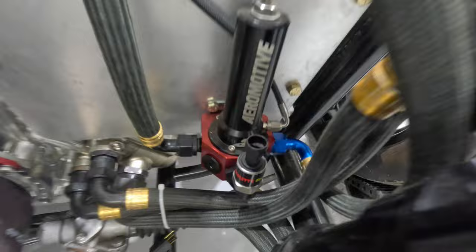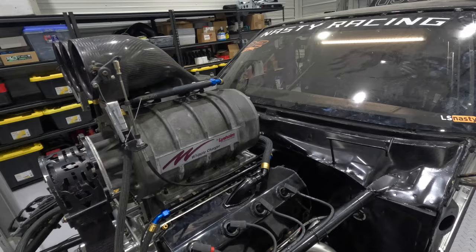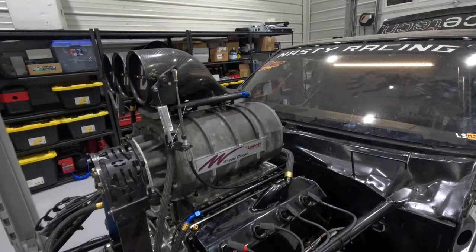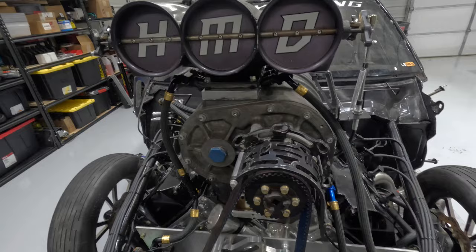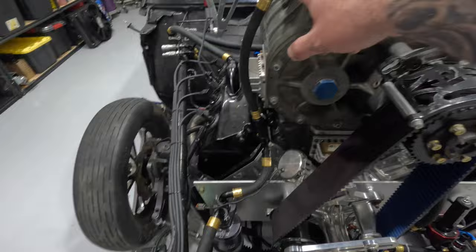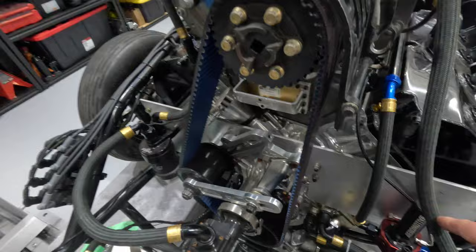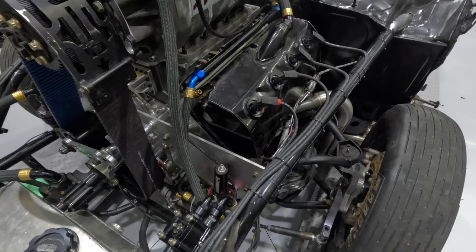There's also a Scarlet Solutions fuel pressure sensor. Something Danny Humphreys — a smart dude — shot me a message about after my last video. He pointed out something I was aware of but hadn't put much thought into. He said he struggled with this on his car, then got it working. The fuel system, as plumbed, comes out of the pump, goes to the filter, comes up to the rail, tees off, goes to the other rail, loops around the back, and we have two returns that come to this regulator.